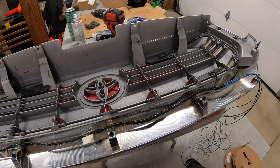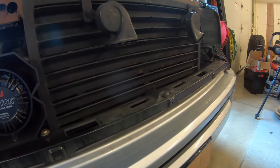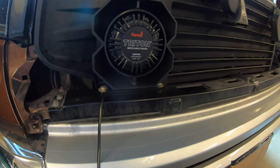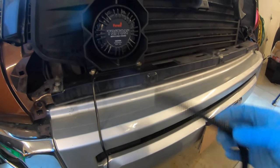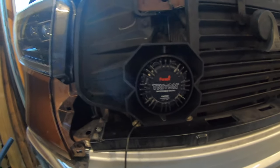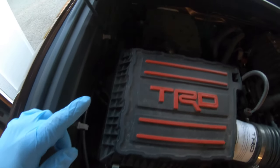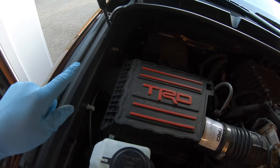The speaker is now installed in that metal support beam that helps hold the grill in place. It's got a little bit of play but it's not that heavy and I bolted it down well. The wire runs out the side with a good amount of electric tape, and then I'll put it inside the protective sheathing. Since the grill lights wires also come out the right side, I'll be able to run both in the same sheathing, snake everything behind here with zip ties so it looks factory.